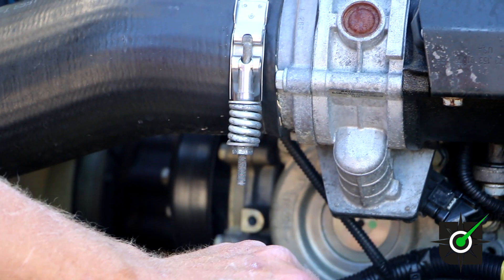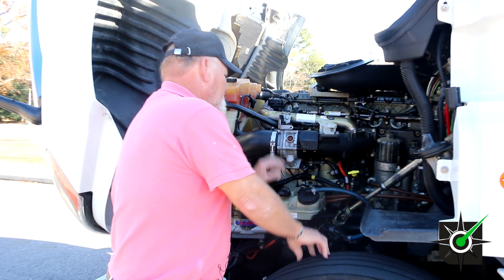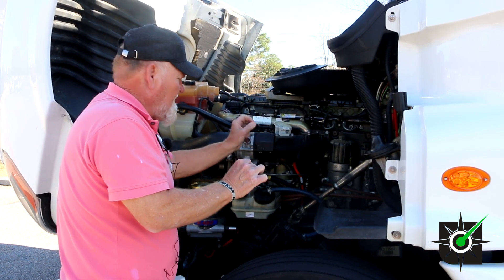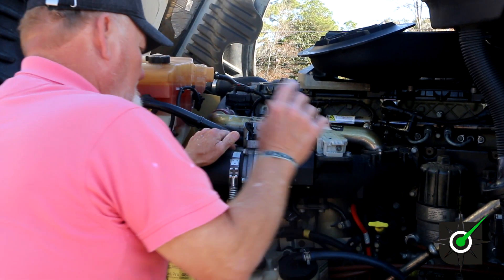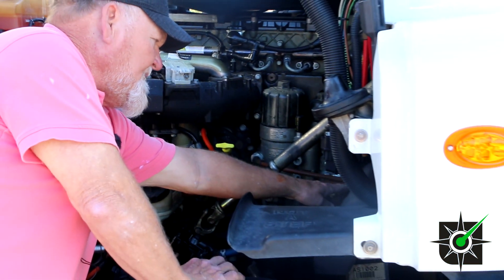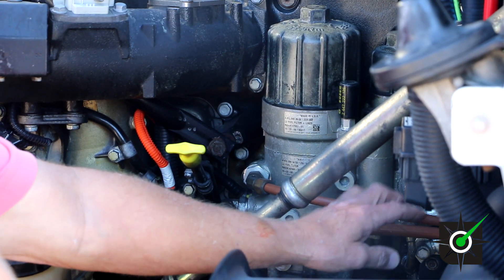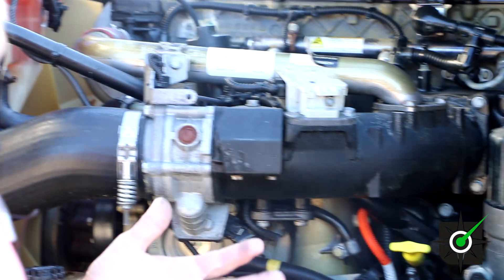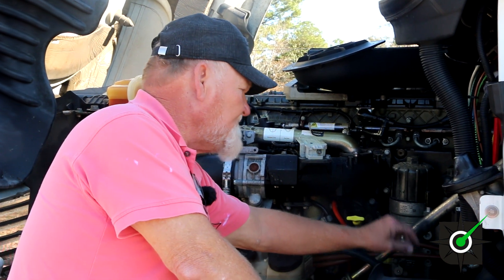From the water pump down to the power steering reservoir — it operates at the proper level, the cap's on tight, it's properly mounted and secure, not leaking. From there, we go to the dipstick — you pull it out, let them know, wipe it off. The engine's not running to check the oil. Pull it out, wipe it off — the oil has to be above the add mark. We'll follow the power steering hose back to the power steering pump and the air compressor. They're bolted onto the side of the engine at the back, so they can't be belt driven — they have to be gear driven. You have to tell them both are gear driven. The air compressor has air so it's under pressure; the power steering has fluid so it can't leak. Neither one can leak. They're both gear driven, properly mounted and secure, bolts are on tight and all present.